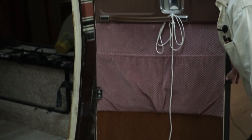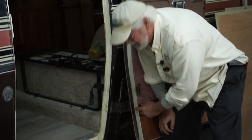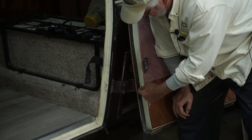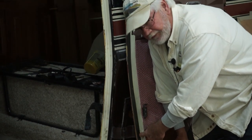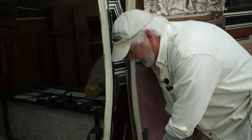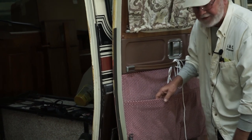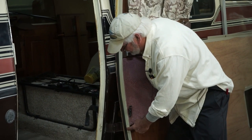Does it move? No, this one doesn't move. Now take a look right here — between these two bolts, if there's a crack, there's a problem. That's where your movement is. This one, Lincoln, it's beautiful. No crack. It's awesome. The color here could be a little better, but your door hinge is in good shape.